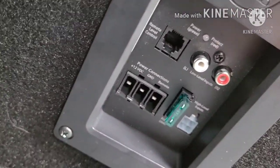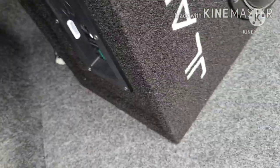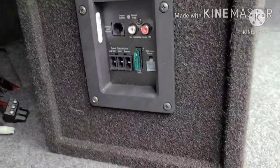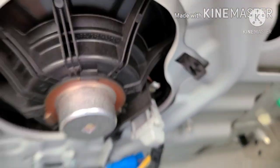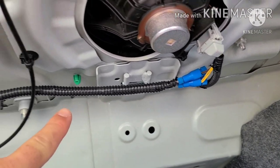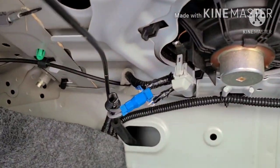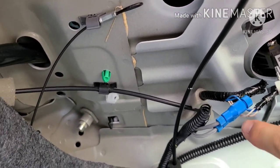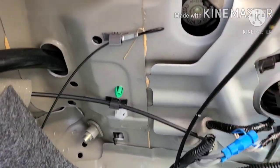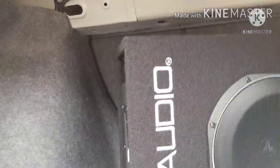The sub is completely out of the car that easily. It's not great for theft, but if anyone's going to steal it they're going to steal it anyway. For the high-level sound conversion, I just tapped the speakers here with these wire taps — this is the right side passenger. You run across with some wire loom to make it look neat; it almost looks factory except for the little taps. Make sure when you do this you tap both wires, because I had a signal problem doing only one. You need to do two positives and two negatives on each tap, otherwise you won't get a strong signal.